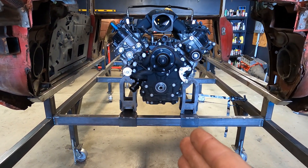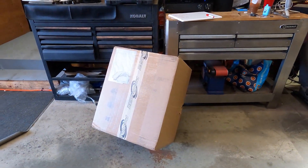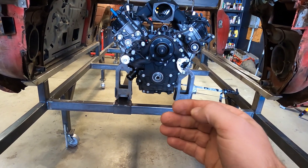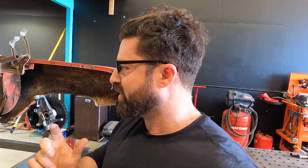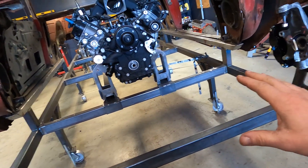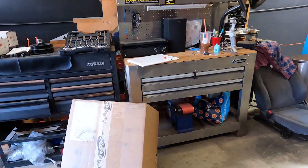As I stated before, it was about 22 inches far back. So I got a mock-up unit with the actual gearbox that we're going to bolt in today to get this in, because that way we can see where this motor is actually going to go. This is going to be a huge visual representation of what this car is going to end up like. Now that I got it on, I can start doing more math and figuring out the front end — getting the diff centered with the transfer case and tying everything together.